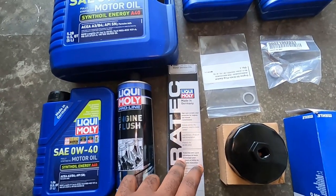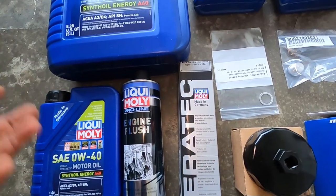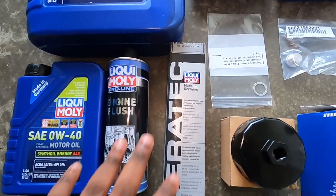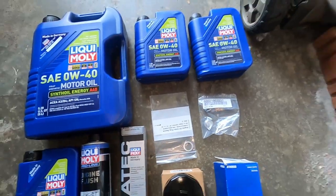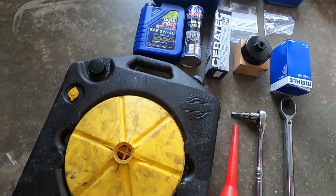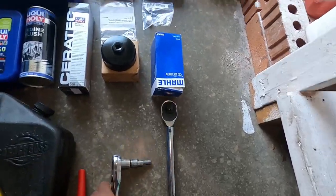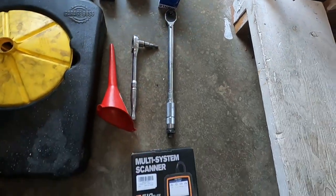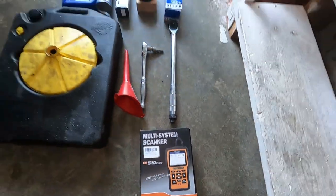The Ceratec right here I use to make sure that all the internals are being lubricated and kind of like waxed to prevent friction for internal components that touch each other. This is going to ensure that there is less friction and prolong the longevity of the engine. This is a car that I want to keep for a long time. You're also going to need a catch can — this is what's going to collect the old oil, and then I'll transfer it to an oil bottle. You're going to need an 8 millimeter hex to remove the drain plug from the oil pan, and a torque wrench to torque everything back to spec. I'm also doing this because I have an oil service light on, so I'm going to use a tool like this to reset the service light.